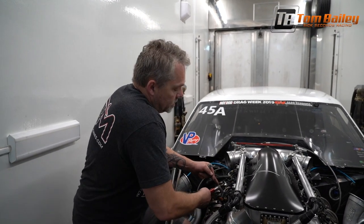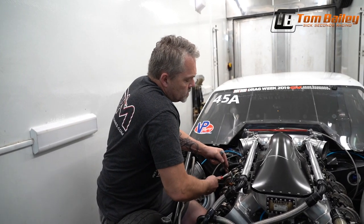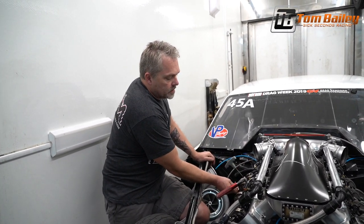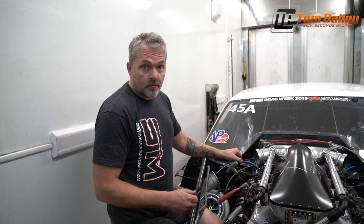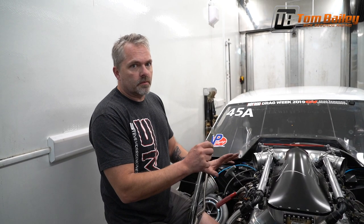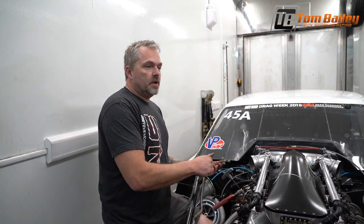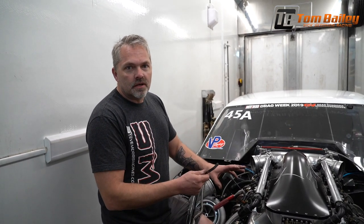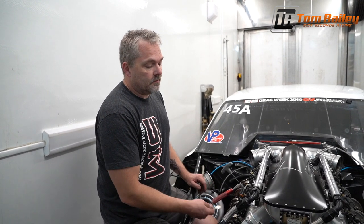Now the other thing I do when we're adjusting is, as I'm telling you, this thing is 5/1000ths cold. Very rarely do I ever adjust valves in a hot engine. In a hot engine, I just do that quick check where I'm just touching them, because they're all over the place and it's very hard to maintain temperature. The valve closes, it touches the cylinder head, it starts cooling down, or heating up actually. The valve's open and it's cooled down, so it just changes. You can roll this motor over, check a valve lash, go over here, come back and check this again, and it'll be off like 1/1000ths or something.